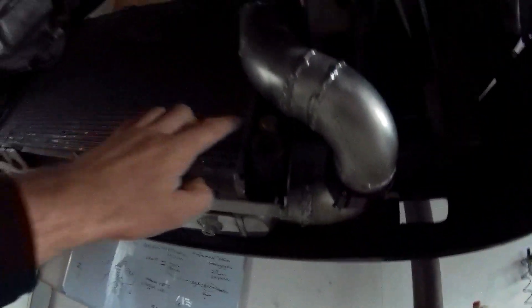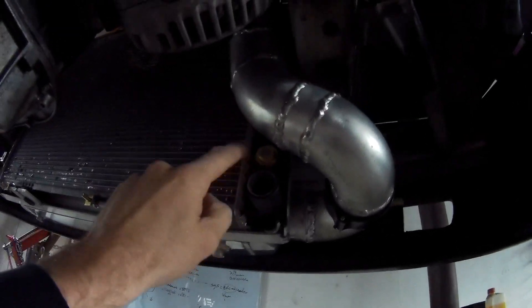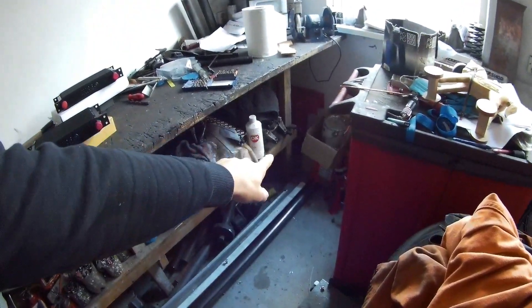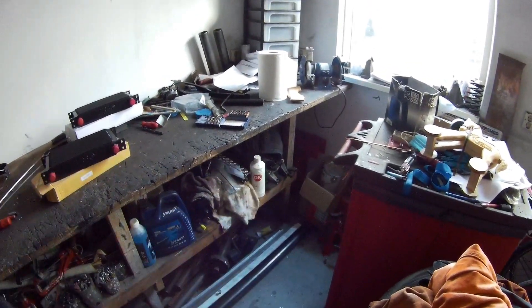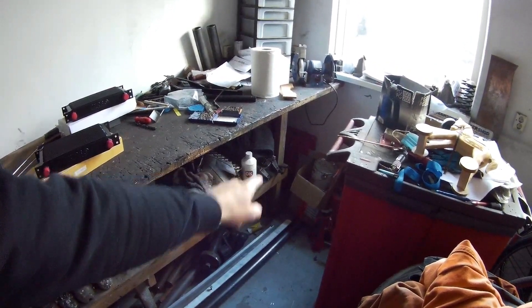This is an original radiator from an E420 — you can see there's an intake. There's a transmission cooler heat exchanger in the radiator. I don't really like that because they tend to fail, and then you've got a broken transmission. The transmission I got in there is from a 4-cylinder C-Class, and it had damage from cooling water because the radiator and transmission cooler had an internal leak.